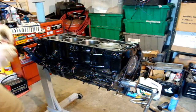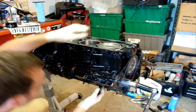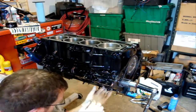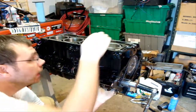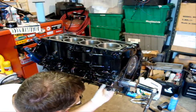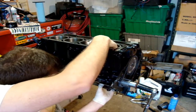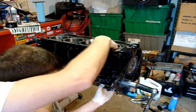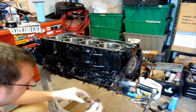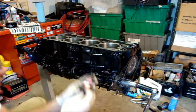Once you get it down, I like to come under here and just kind of give it some taps until I can get my hand in there to guide the rod into place. And once it's lined up, give it a good push until it makes contact, and then I grab the cap, which also has assembly lube.